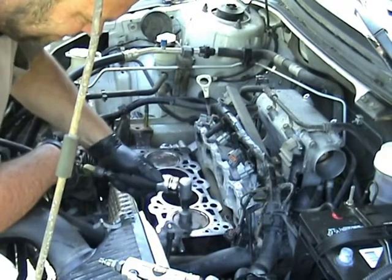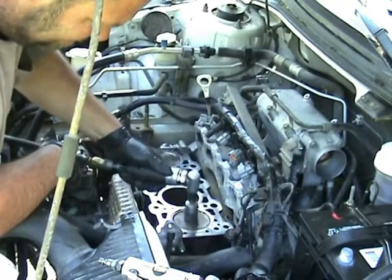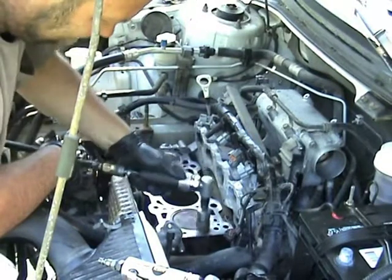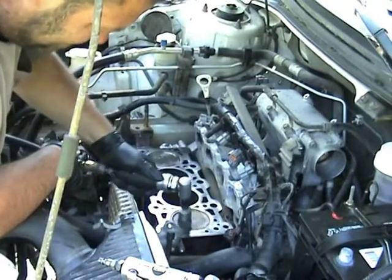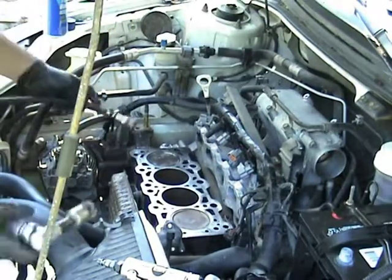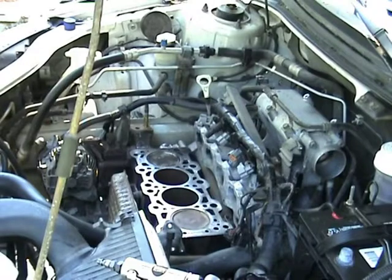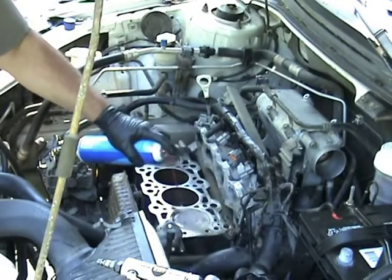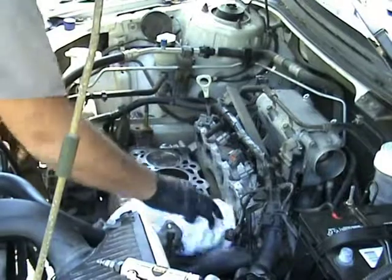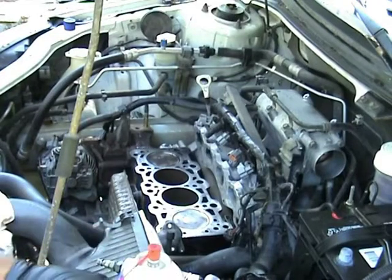You can take a clean off the top of the piston — clean your carbon off of it. What I always do is take carb cleaner with the hose and spray air around the rings, just to get that carbon out of there. I'll wipe it off. That helps clean up the piston and get the carbon out of it.